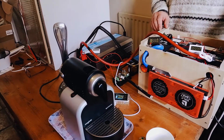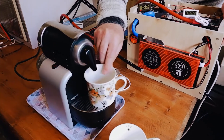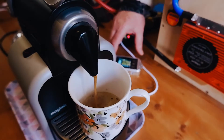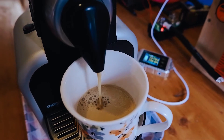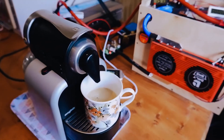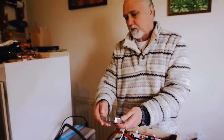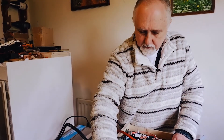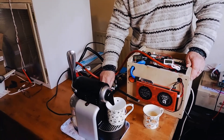It's ready now, so let's start the first cup of coffee. We're going to make two cups in this test. Straight away the amps go up again — to just over 100, staying around 104 to 105 amps. That's about enough water for the first cup — this is obviously subjective as to how much you pump in. The first cup has taken it to 1.4 to 1.5 amp hours used so far. Getting ready for the second cup, we're on about 1.6 amp hours.